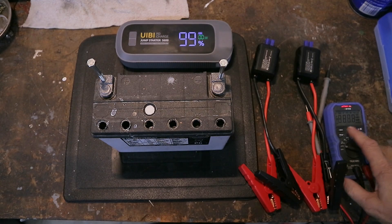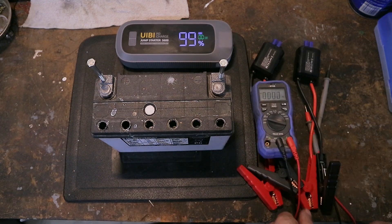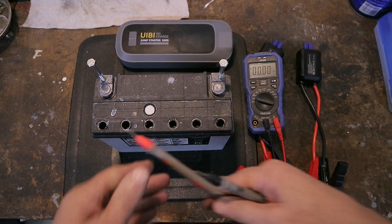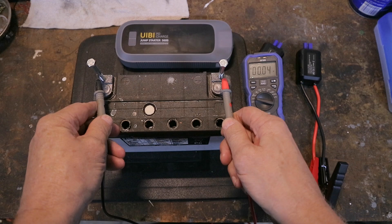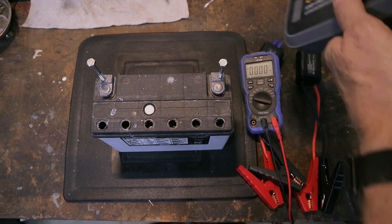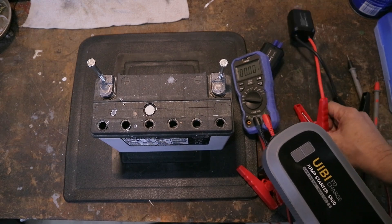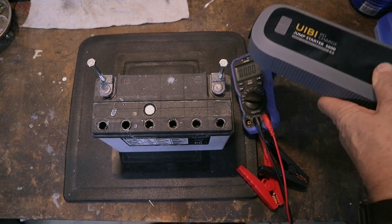Let me demonstrate. I'm going to set my meter to volts and set the range to 99 volts. I'm going to check the dead battery and you'll see it's got zip - it doesn't matter which way I connect it up. So when we connect the jump starter, I'm going to put in the one I know is good, because it was the clamp that was no good in the first unit they sent me. I'm going to connect up the one I know is good and show you what happens.